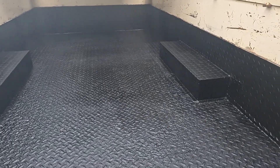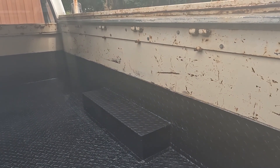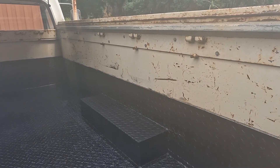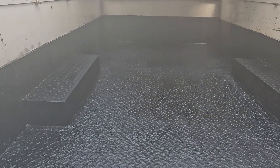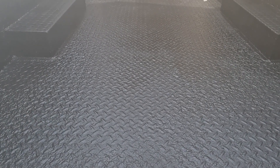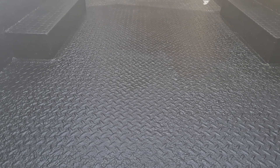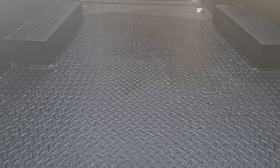It's been drying over 12 hours now. I pulled the tape off. I've got one spot down on the side over the wheel arch that ended up with some bed liner up high. Overall it looks real good. There are a few spots on the diamond plate up towards the front where you can still see the floor under it, so I'm going to put one more coat on — that'll be three coats on the floor. Other than that, I'm pretty well done with putting the bed liner in. We'll give it a while and I'll see how it holds up. Thank you for watching CC's Garage and come back again.